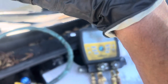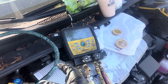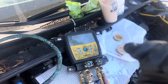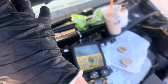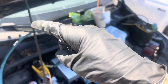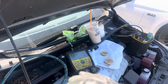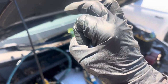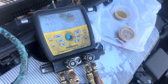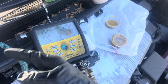You can see our superheat is falling as the interior temperature of the vehicle falls — we have less load on the evaporator. The refrigerant expansion valve could only feed so much refrigerant — it has a rating and cannot flow any more. At 121 degrees air flowing over the little tiny evaporator, the majority of the refrigerant was going into the evaporator through the coils and it was literally flashing off — before halfway of the evaporator core there was no more liquid to do any work. It was saturated, reached near zero, and then started raising in temperature. That's why we're going back and forth — up to 42 — and we definitely got some negative going on there on the subcooling — I always mix those two up.